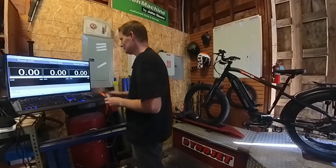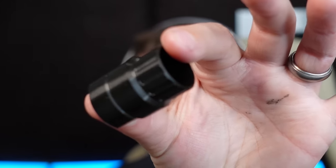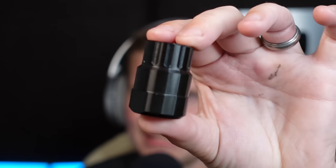Let's stop it and see what the official numbers are. But real quick, I've got to tell you about the sponsor of this video: Area 13, and in particular our brand new freewheel removal tool. Previously they were made out of 4140 steel; we've since upgraded them to a new 51CrV4, which is then black zinc plated. That means the new tool is both stronger and more resistive to the elements. I designed this tool a few years ago specifically to use on Bafang hub motors — if you buy a normal freewheel removal tool to change the freewheel cluster of gears on the motor, you'll find the tools don't fit over the motor cable. So I went ahead and made our own. This is the newest latest and greatest version — these are in stock at area13ebikes.com. Now back to the dyno results.